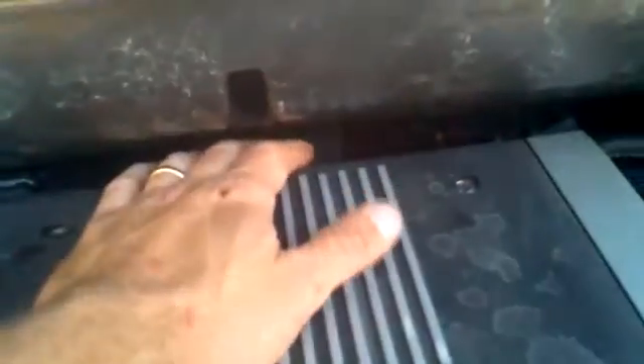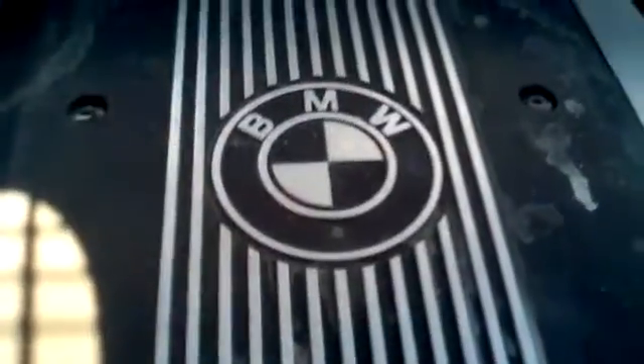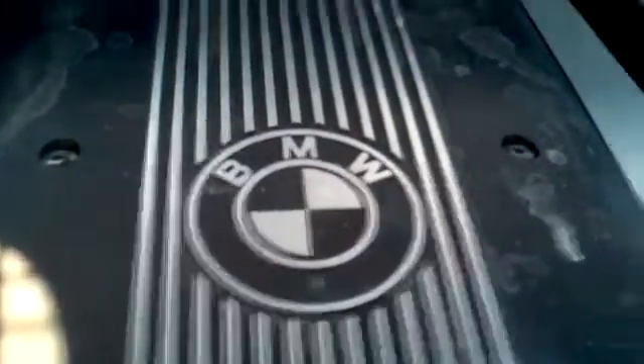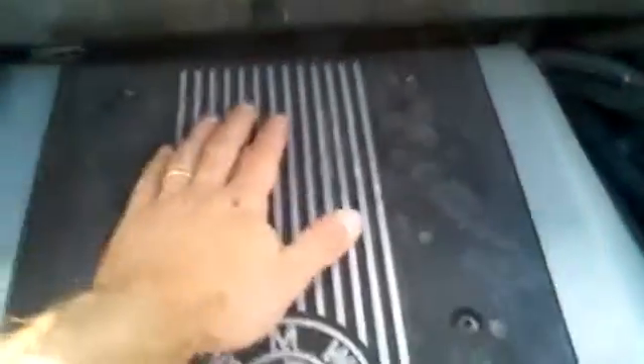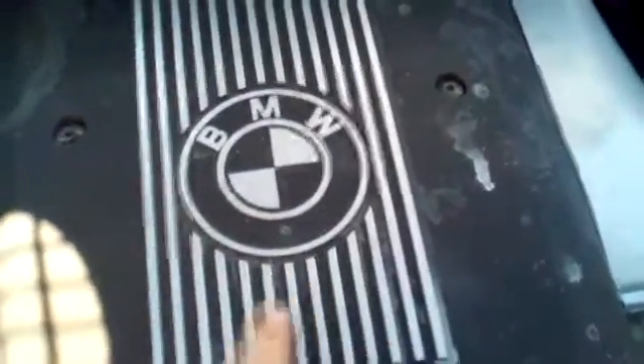One other thing I've seen on this is that the rear PCV plate, which is back here on the back of the intake manifold, fails. The intake manifold fills with oil and you're going to end up burning oil, using more oil than you're used to, and you might see smoke from the exhaust on a first start. The fix is to remove the entire intake manifold and do a reseal — replace the rear PCV plate, replace the gasket in the front, replace your intake manifold gaskets, and it's also a good idea to spray out and clean the intake manifold.